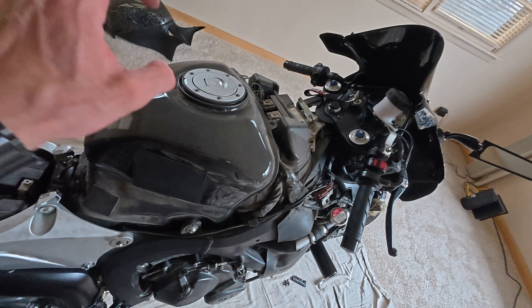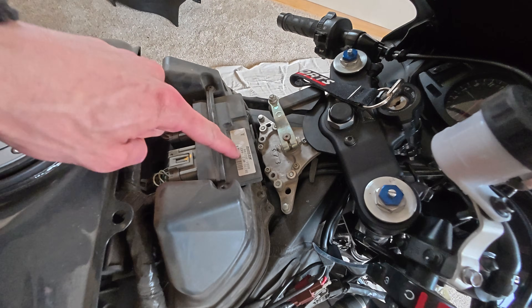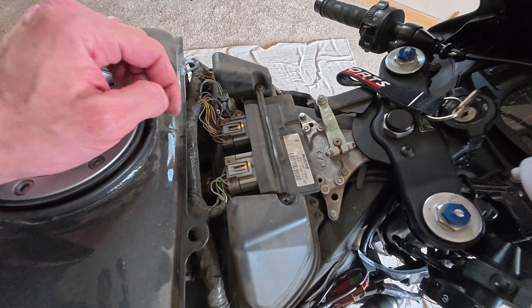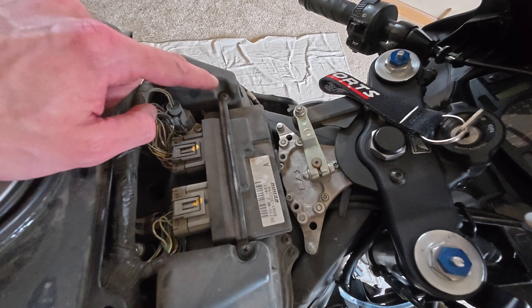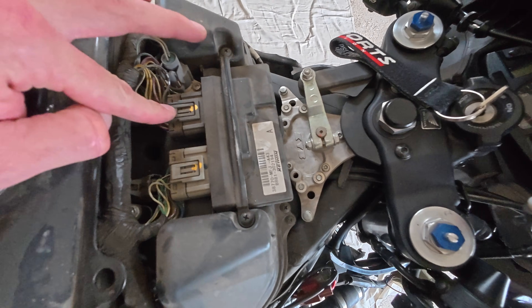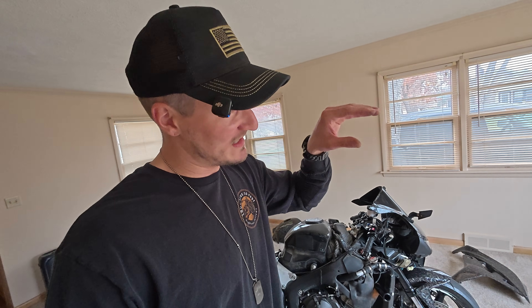Looking at our CBR now, there is that gas tank in the rear portion under that tank cover like I talked about. And the ECU — bam, right there. You'll notice it because it has a gray and a black plug, usually. I think they all have a gray plug and a black plug. There's just this one little crossmember bracket here — it's just two Phillips screws that hold that on. Then I'll push these tabs and just pull those plugs, wiggle them side to side to get them out. It does not take sheer muscle. If you're pulling on any of those fairings and they won't come, you've still got a fastener — some tab clicked in. You just need to follow around and look.